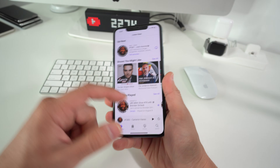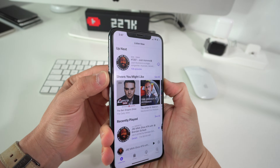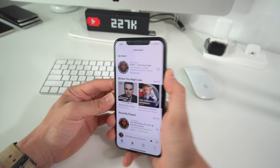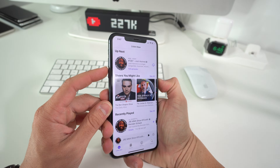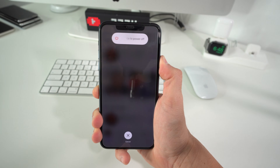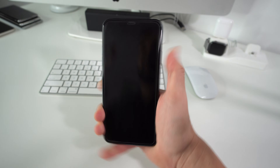So for example, let's say you're stuck on this app and it's not letting you swipe up or do anything. What you will do is press volume up, volume down, and then press and hold the power lock button right here. You're going to hold it until the phone completely turns off, then once it does you'll let go and it will turn back on by itself. Let's do it now — volume up, volume down, press and hold the power button. It's okay if you see the slide to power off — you don't have to touch it, just keep holding the power button.